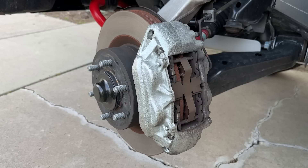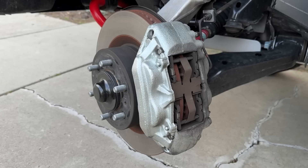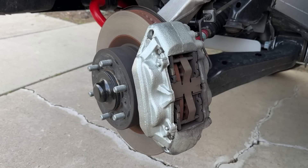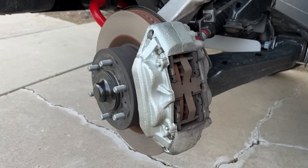Like the last generation, the new Tundra's front brakes — TRD or otherwise — are four-piston fixed calipers. You can count one, two, three, four pistons. It's an open window design where this is completely open — you can pull two pins and pop the pads right out when you want to change them. You wouldn't see that on a track car with six pistons; there'd probably be something across the middle requiring the whole caliper to come off. But in a vehicle like this, which is more for routine use, this is pure convenience when it comes time to change brake pads.